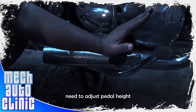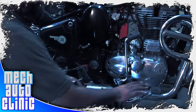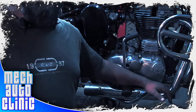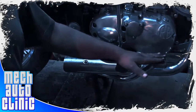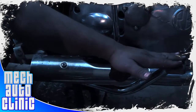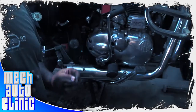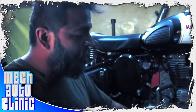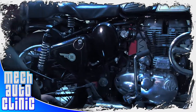Right now I've got a small sound, so I'm going to lower down this brake pedal slightly so it will not hit the header, but I won't lose the level alignment between the footrest and brake pedal. Sometimes you hear a 'tong tong tong' sound - that means your brake pedal is basically hitting the header. So you have to lower it down.